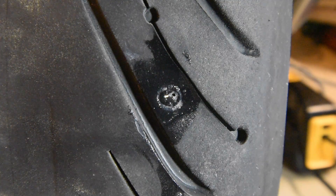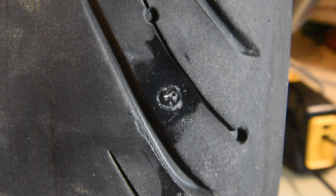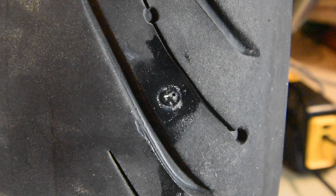One thing they said is when plugging a tire that has steel belts, if you feel a lot of metal-to-metal contact while reaming it out, you should replace the tire or vulcanize it from the inside. I don't expect to have this tire on for much longer, but I just wanted to practice plugging a tire because you don't get this opportunity too often — so I wanted to try out my Stop-and-Go.